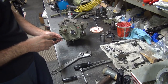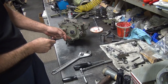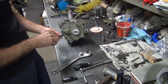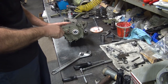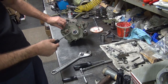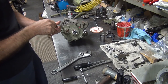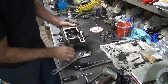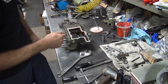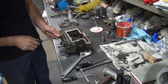We have a lot of things that are different than what was mocked up. We now have the dowel stud in here. We changed out this one stud that's real tight instead of being loose. And the gasket shrunk up a little bit. And we got the rubber seal in here. And all of these things are causing issues. And we also put the push rod seal on the other side, which is putting more pressure on everything. So everything's kind of fighting us a little bit right now. And I also want to make sure these gears are free under here before I start forcing it. So they are, so we should be good on that. So I'm going to go back to tighten this up a little bit.